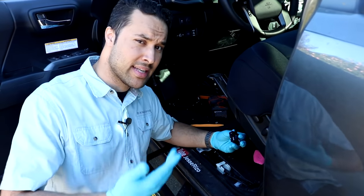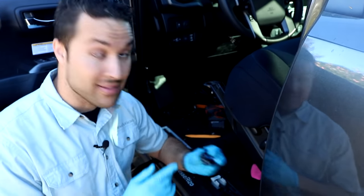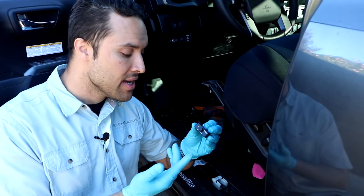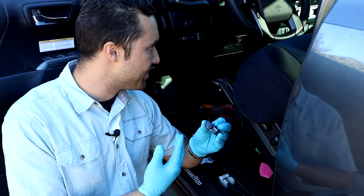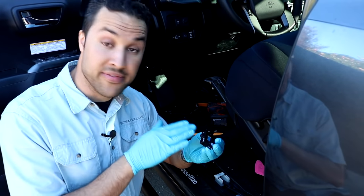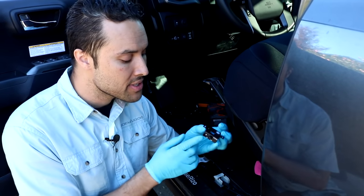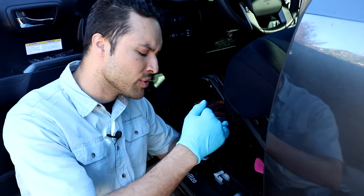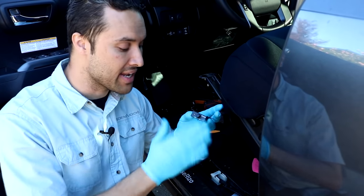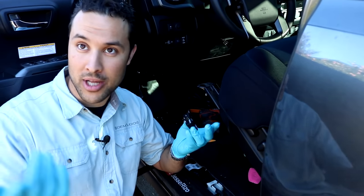It's kind of for the set it and forget it listener, where they find that sweet spot and never touch it. The light's pretty bright though, right? Yeah. So an option, if you find the light to be a little bright, whether it's hidden or even visible, in any other case, I would suggest you can diffuse it by loosening these number two screws on the top, pulling the light back into the assembly, and putting a little piece of masking tape cleanly on the inside so it doesn't aesthetically compromise the look. It'll actually diffuse the light and make it more tolerable at nighttime.